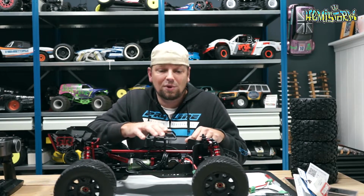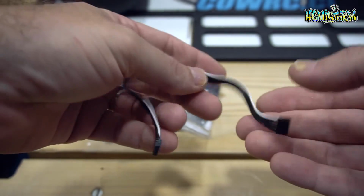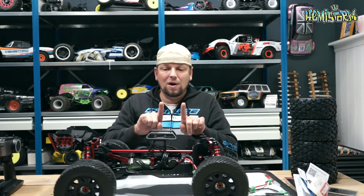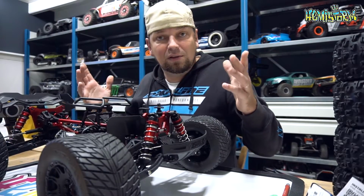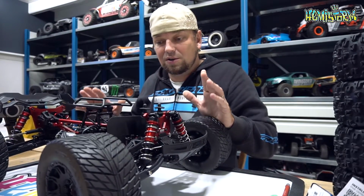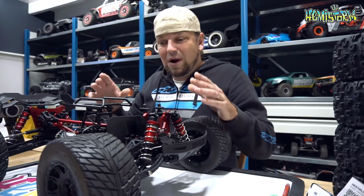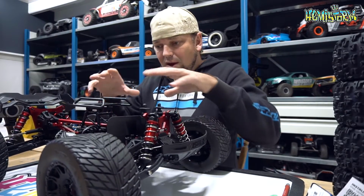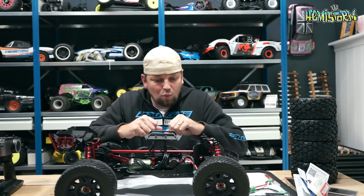If you do purchase one of these Direct Connects, I will make sure that there's a close-up of it. Don't be confused and think that there's something wrong with the white wire transferring itself from one plug to the next and then crossing over with one other wire, because that is exactly what the sensor harness did in the past. All of that is now built into one wire, making it a bit cleaner and a bit more tidy once you have everything put into place and wired up.